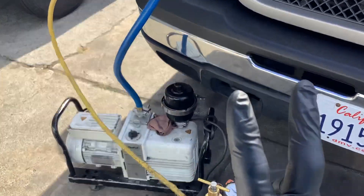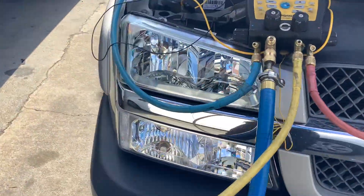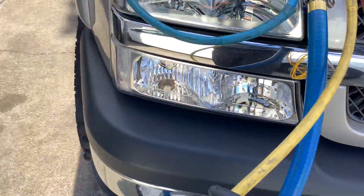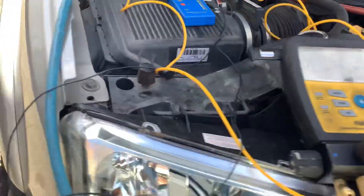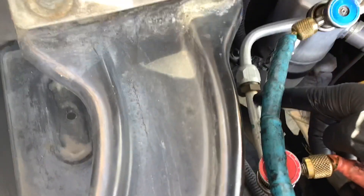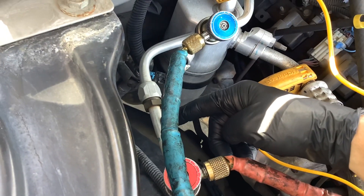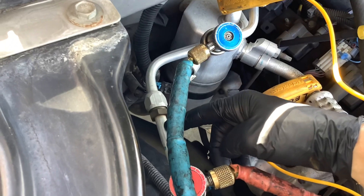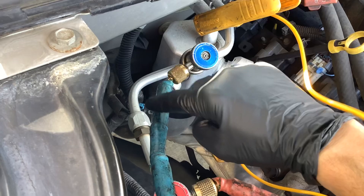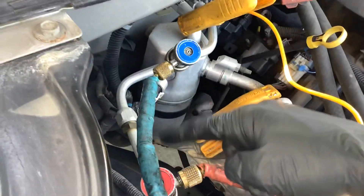In video three I'm ready to add the dry nitrogen to the system for the pressure test. I already installed the dye — it's in the low side. I'll be chasing the pressure of the nitrogen up through the high side only, and it'll enter the high side. In between the high and the low we have the orifice tube right here — for HVAC guys this would be like your cap tube or your piston, basically a control orifice that's only one size. It'll push the dye that I put in here right into the evaporator.